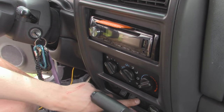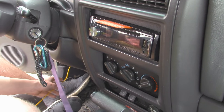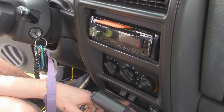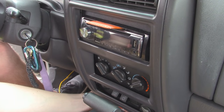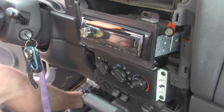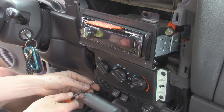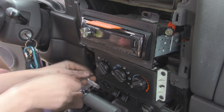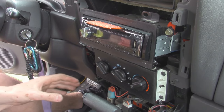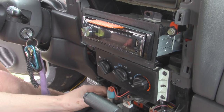The first thing I'm going to do is pull out this panel so we can mount our switch. And as you can see over here, we have our wire from inside the engine bay, and it comes down right over here where our feet are, so we're going to tuck this up and zip it up with the factory wiring harness and lead it all the way to where we're going to put our switch. For this cover, basically we're just going to take our hands behind it and pull it back — it pops out of place. Then we have three Phillips screws that hold in this bottom control panel: two on the driver's side and one on the passenger's side. So there's a bunch of electrical connections — basically you've just got to unplug everything, and then we can take this out and cut it when it's out of the Jeep so it's a lot easier.